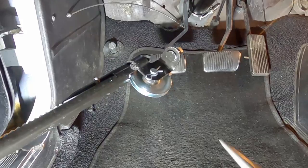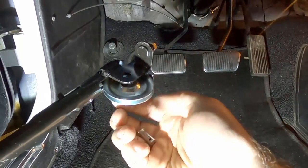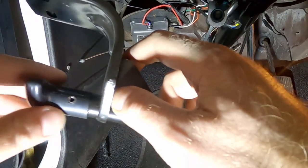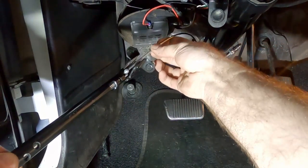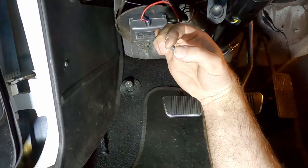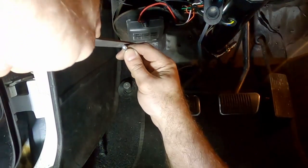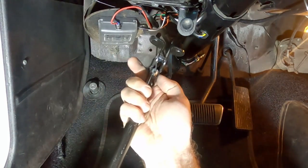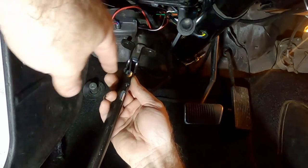We need to disassemble the handle just a little bit to get this pulley out of the way — pull the cotter pin out, pull the pin out, and get the pulley out of the way. There's a little latch up here — lift that up and push the mechanism back to expose the end where we put the head of this cable in and trap it inside. The end of my cable has a little tip I need to cut off because it should be more of a ball that fits in this socket. This needed a lot of work to get that ball shape to fit in the pocket — had I known I would have test-fitted this on the bench before doing all this work in the car.